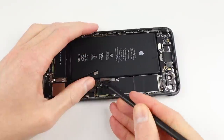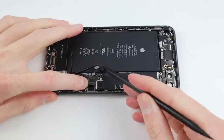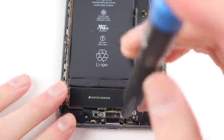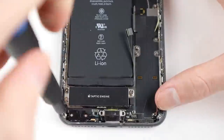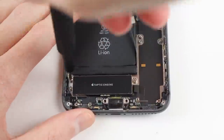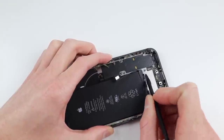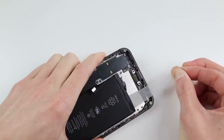The first thing I'll need to do is remove the logic board from the phone as that's the biggest part and will need to come out first. With that removed, I can begin removing all of the smaller components inside of the phone. Now because I'll need to do a full housing swap on this iPhone 8 Plus, I'll need to remove every single screw and every single component from the phone which I'll transfer across to the new housing. I will also need to remove the Taptic engine before I remove the battery from the iPhone, as this will give enough clearance to hopefully remove the battery tabs without breaking them off, which otherwise would require me to pry up the battery with force.